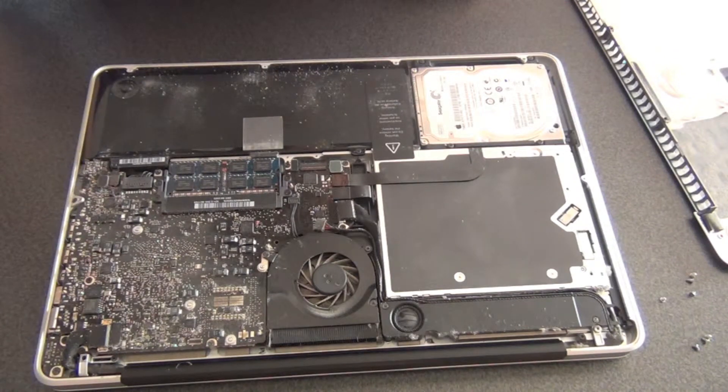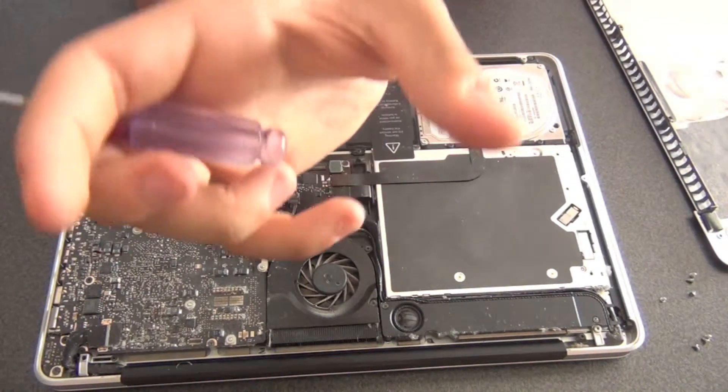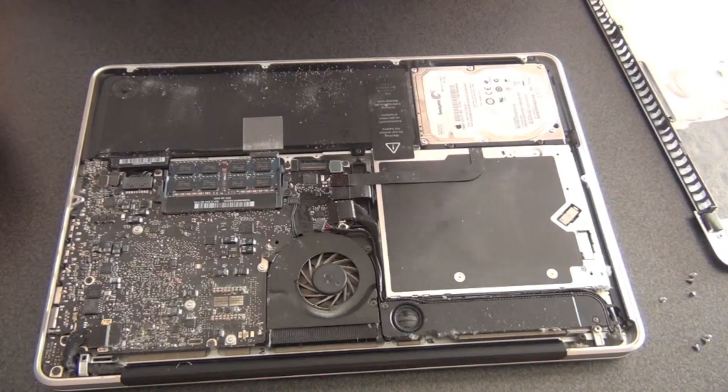However, you must absolutely not use one of these abrasive cloths that have the magnetic sort of dust thing that sweeps them up. These can cause false contacts and can eventually permanently damage your device, so I really recommend not doing that. One way you can clean it is with a very light cloth, like the ones used for LCD screens. Or if you want to be more efficient — a bit more risky — you may also use a small vacuum cleaner. There are USB vacuum cleaners that are pretty good for computers; they're not very strong and they do the job.